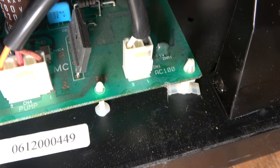5.6, I think. It actually seems to break down. I've done it on a power supply with very low current limit. Breaks down just under 6 volts. So I'll fit that temporarily while I order the proper one. But why does it even have it?